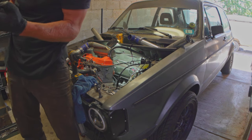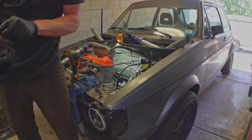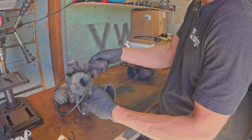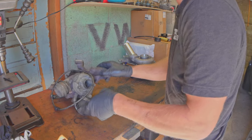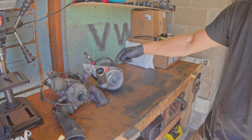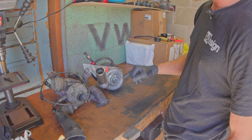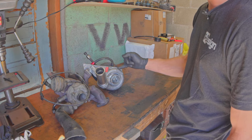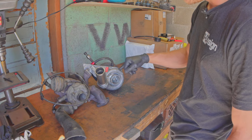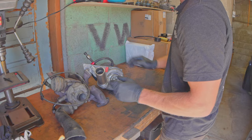There's definitely some oil back pressure blow-by - there's hella gunk in there. The vanes are honestly decently gummy themselves, but still moving. This is a turbo off of an ALH - it's a pretty small turbo. If I had to guess, I'd say this is probably like a GT15. By comparison, this is a GT22, quite a decent step up in compressor size. Honestly, this turbo is pretty big for my 1.6. I get surge if I drive with too much boost at too high a gear, but I expect that once I put the ALH motor in, I'll no longer have such a bad surge problem in higher gears.